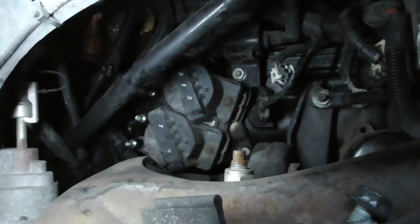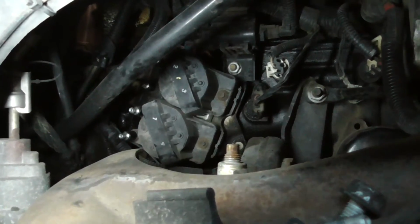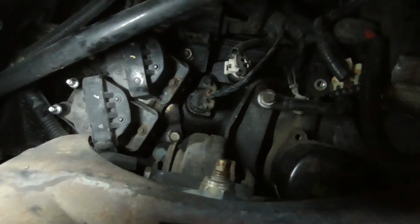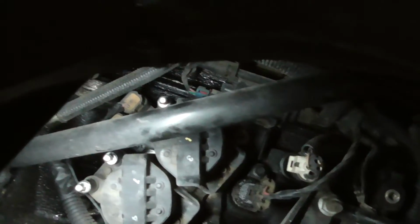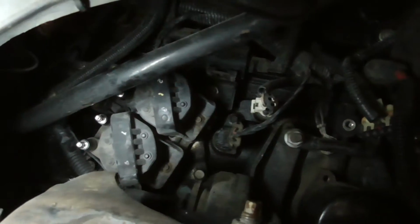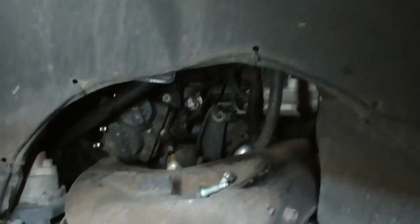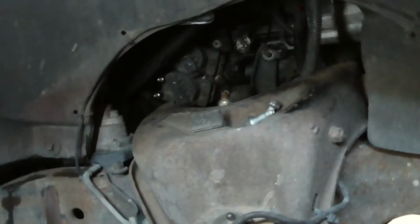So I'm going to go ahead, like I said, take my new coils, number them, take one off at a time, number them. Like I said, those are either 7s or 5s. I'll let you know after I get done. But that one's going to be a pain, because it's right in the way of the transmission dipstick. I'm going to get those out, number them, and then I'll see which spark plug wires are which, number those, and then I'll come back.